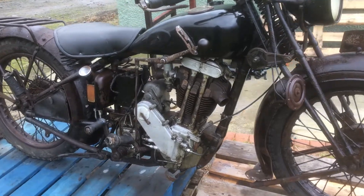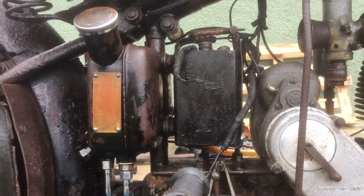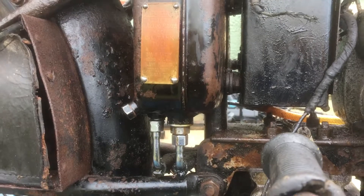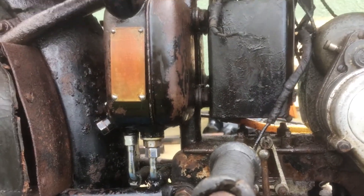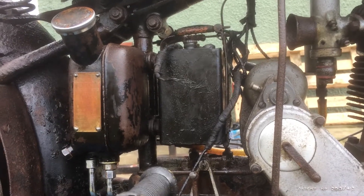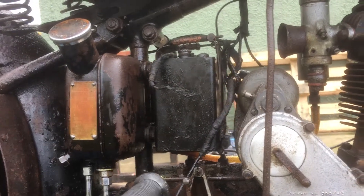As I get in closer you'll see there's a little brass plaque on the oil tank, and that brass plaque states in no uncertain terms: 'as far as is reasonably possible, keep oil tank full.' So I filled the oil tank. I used oil I had lying around - there was a litre of SAE 30 that I chucked in, that was for my lawnmower, and topped it up with 20/50 that I use for my Commando.